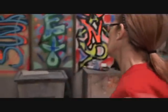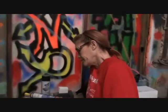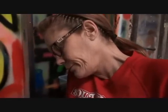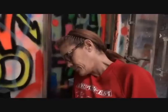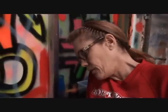You can't just throw it in there and prime it. What's going to happen if you do that? The primer will not stick properly and you're going to screw your paint job up. Let's go in the paint booth so I can show everybody and explain to them what we're talking about.